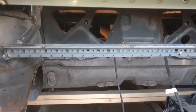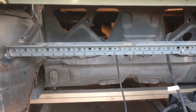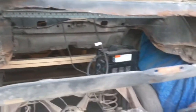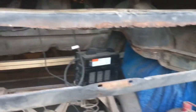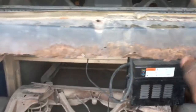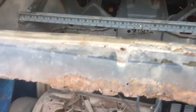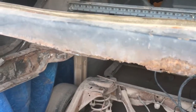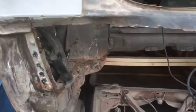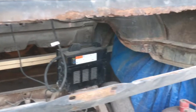That's how I do it. I don't think I really need the one inside, but I put it in because I'm also gonna be replacing the quarter panel on both sides, so I just leave it since I already welded. Everything is coming out pretty good. This piece is coming out now. I still need to order that trunk piece, so right now I just leave it — doing one thing at a time. It's not gonna bother me; it's keeping everything stable instead of cutting it and things shifting.